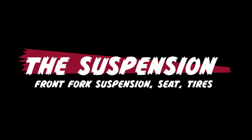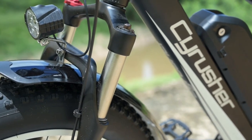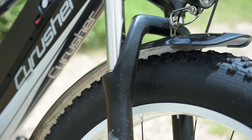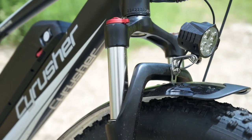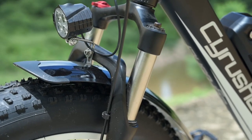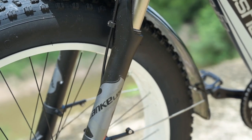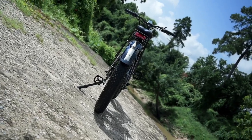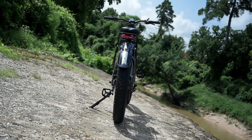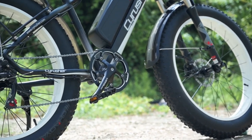Next, let's talk about the suspension. The XF650 has front fork suspension — a coil system with hydraulic lockout and preload adjustments, 80 millimeters of travel, and 35 millimeters of deformation. If you're a mountain bike enthusiast, 80 millimeters is not enough for jumps, especially on a bike this heavy — pretty much twice the weight of most mountain bikes. This is not going to be enough for the bike park. As mentioned, it is a hardtail, so there's no rear suspension.